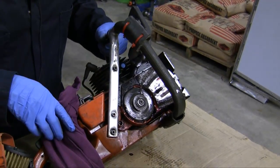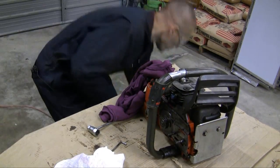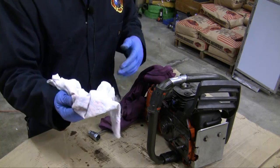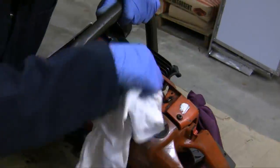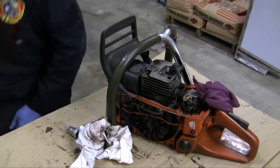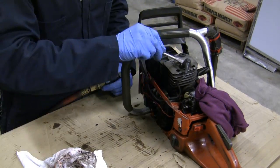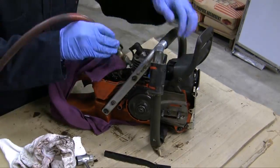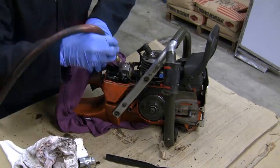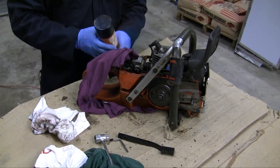The magnet is right here — you can see my screwdriver sticks to it. When this magnet passes by the coil, there's got to be the right amount of clearance between those two parts to make electricity. If grime builds up in there, I don't have that clearance, I don't make electricity, and the saw doesn't go. My saw is pretty well exposed now — opened up on three sides — and I'm ready to do a general cleaning. First I'll just take a rag and start wiping the big stuff away, then hook up my compressed air and blow out what I can.